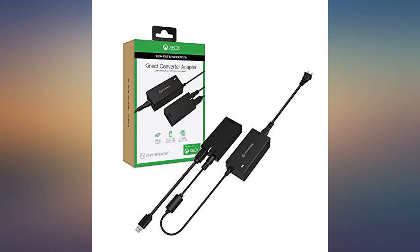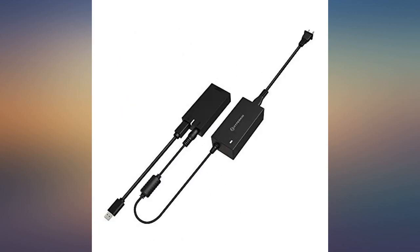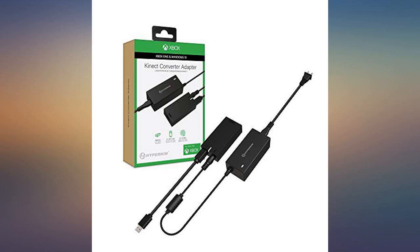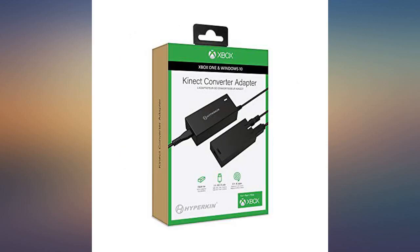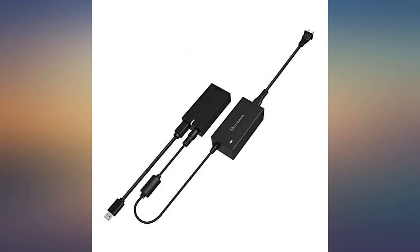You'll just end up having to go through the hassle of returning it. So good job Hyperkin. I tried two cheaper adapters from China and they were extremely glitchy. This one works well — working just fine at 30fps with zero drops. It's linked to a Vantec USB 3 with a Renesas chip. Make sure card drivers are updated to the latest. Unplug before installing and upgrading drivers, otherwise the Kinect sensor won't get the right driver loaded on it.